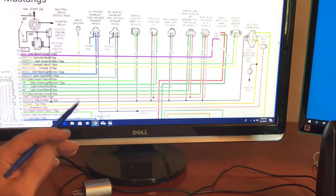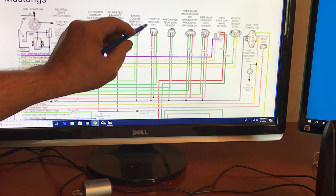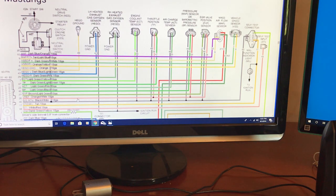I'm not saying I'm an expert, but I hope this helps you get started — don't be afraid to get in there. Your ECU computer is in the passenger side kick panel. Pull that out; it's a number 10 bolt under there. You'll see that connects the pins to the ECU. Mark those and trace each wire down to make sure it's right. Get yourself a meter — there are also videos online on how to test your throttle position sensor. There are a lot of Fox Bodies out there with wiring issues, and you can do this. Good luck!